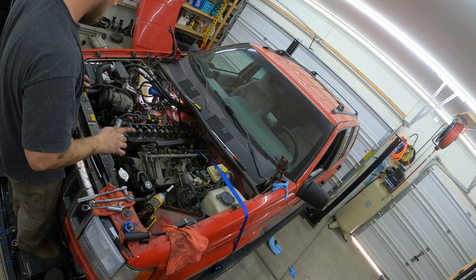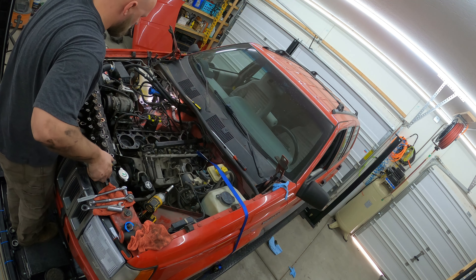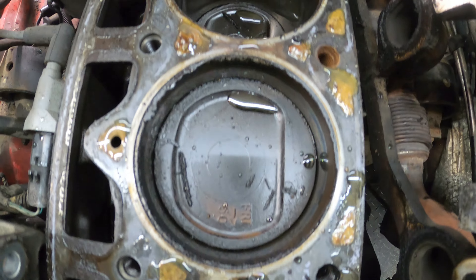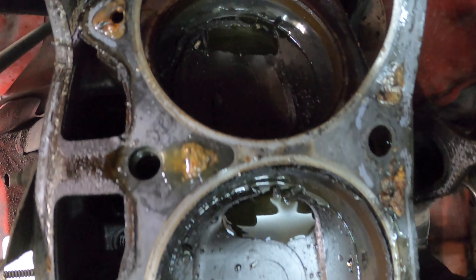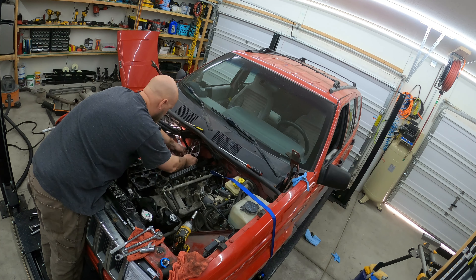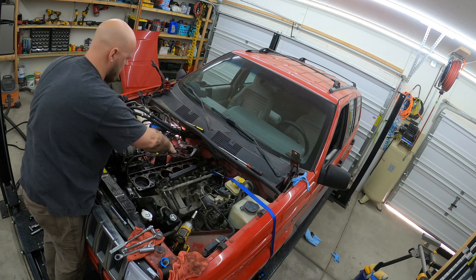At that point I used a little breaker bar and just popped the head off the block. This thing is super heavy — I actually make it look really easy in the video. Down here are your pistons and cylinders. The coolant in there is probably just from the head — I don't think coolant is running in these cylinders, it just happened when I pulled everything apart. But that's your gasket — you're going to have to remove that and scrape everything clean. It was a pretty heavy duty gasket; with 250,000 miles on a 1994, we're just doing this as a preventative measure.